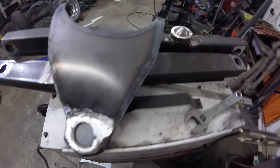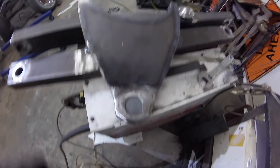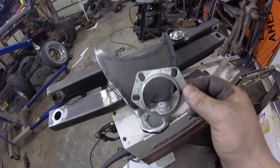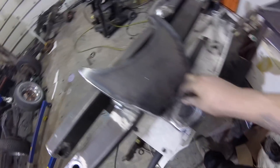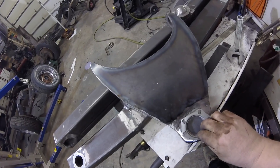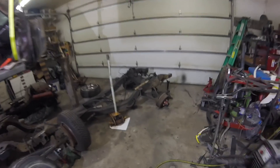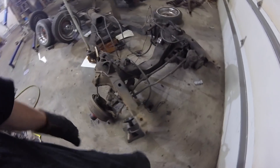I'm calling it done. Once I get the actual ball joints I'm going to use — these ones I have are just a cheaper version of the Unbreakables, but they still have the same bolt pattern so I could line it up. I might just wait until I get the actual ball joints. They're sitting there like that so we should have plenty of room to make that work. Now on to the lowers. I'm going to start with the passenger side again, like I did on the upper control arms, because that way if I screw up real bad, I'll know how to make the driver's side nice — and the driver's side is the one I'm always going to be looking at.